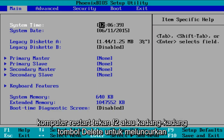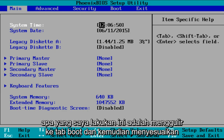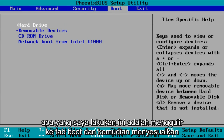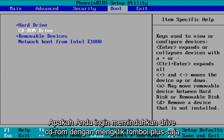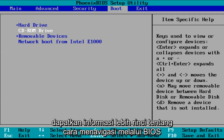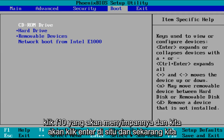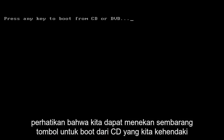We are going to boot from the Windows 10 setup installation. Now as the computer is restarting, press the F2 or sometimes the delete key to launch the setup utility window so we can change the boot order and boot from the CD. Scroll over to the boot tab and adjust the order of which items will boot. Move the CD-ROM drive up by clicking the plus key. Follow the instructions in the bottom panel of the BIOS. Then click F10 which will save it, and click Enter on that. Now we see we can press any key to boot from the CD, which we will.